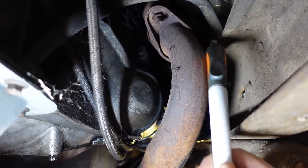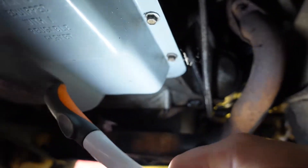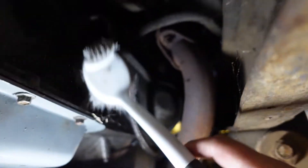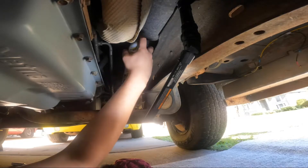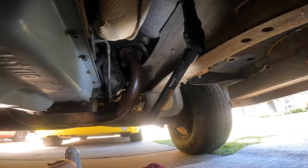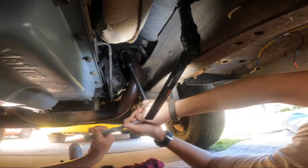So here's our dilemma. Initially we thought we needed to release bolts off the turbo from the top, but now I'm looking at the service manual and it's showing a different approach — way easier. It's showing that to remove the turbo, I need to go underneath and separate some crossover pipes, left and right. You release that part from the bottom, then pull the turbo out with the pipe and all. It looks like it has to be approached from the very bottom.